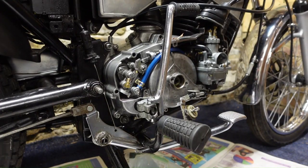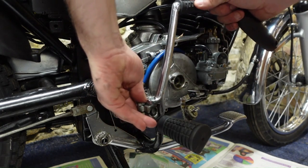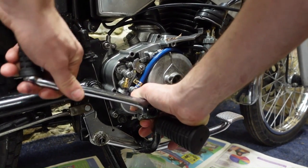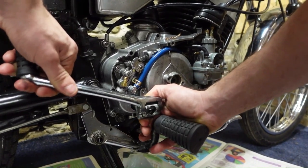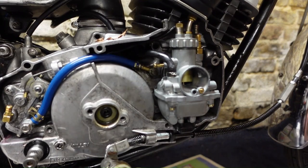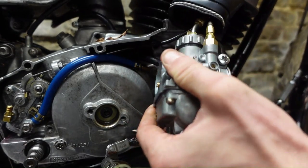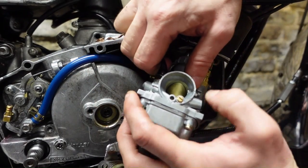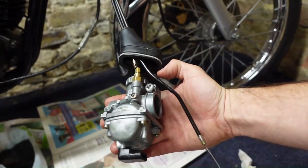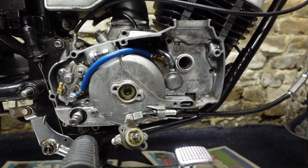While I wait for the oil to drain I'm going to take off the side stand - it looks like it's just a size 12 and it'll give me better access. I just have to turn it first and pop it off nice and easy. There's the side stand off. I thought I might as well try and undo this carb - there's a little screw in there, and then I take off the petrol hosing and this cable that goes to the oil pump. For a 23-year-old bike that is exceptional - really cool. Someone has done a lot of hard work on this already.